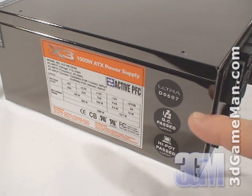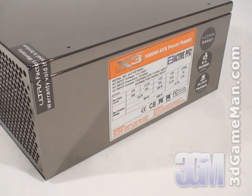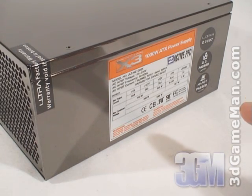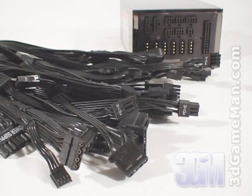Fourth, I recommend getting a power supply that has APFC. APFC, or active power factor correction, also assists the power supply in being more efficient and therefore stable under load. APFC basically reduces total harmonics, corrects input voltage, and allows for full input voltage range. Thankfully, this power supply has active PFC.